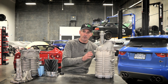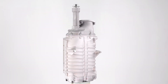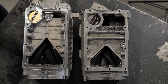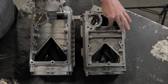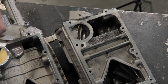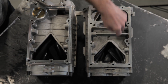This item will bolt directly to the factory intake runners in place of the stock supercharger. Looking down on them here, you can see that the opening that connects to the lid is the same size, but the biggest difference is actually in the length. Looking at this dimension, this is the length of the screws on the 1900 — if you look down in here you can see the top of the screws. At the end of the casting, you've got roughly 175 millimeters of rotor length.